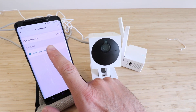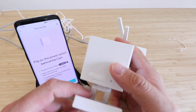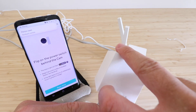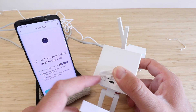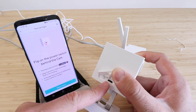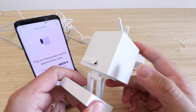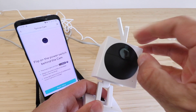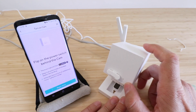We're going to click 'Add a Wyze Cam Outdoor.' It says flip the power switch on behind the camera. On the back, you need to open up this little port — it has a rubberized coating. That's also where you charge the device. I recommend charging it for at least 20 minutes before setup, though you can also plug it in during setup. Flip the switch to On — you can see the light on the front comes on. We'll also peel off the protective coating on the lens and then go back to the app.